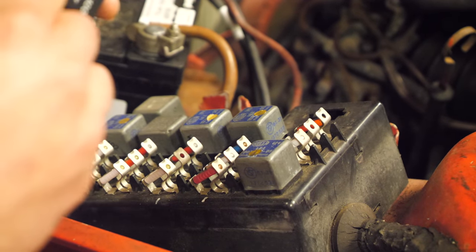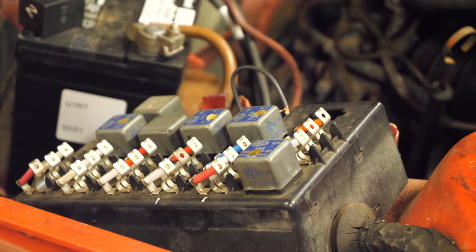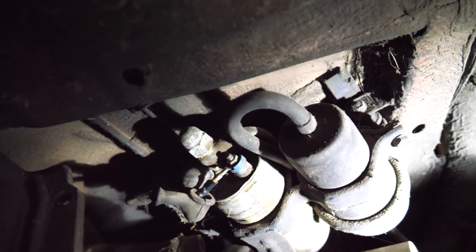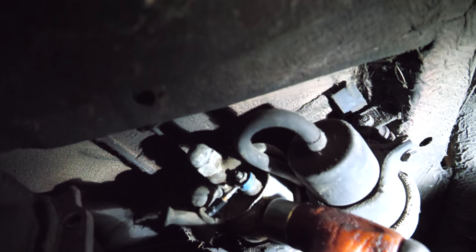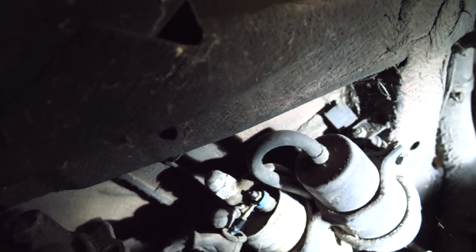We need to go between pins 87 and 15 — that's key on. There we go. We're just going to let that hum on its own and let's go hit the pump. The pump's making some pump noises. Give it a couple more taps. You can hear it — it's kind of doing stuff. So now it's happy again.